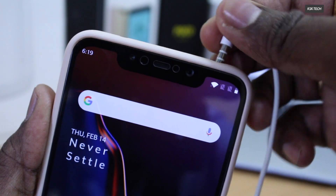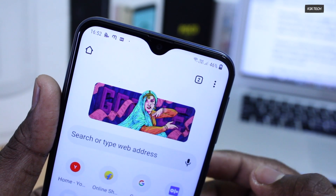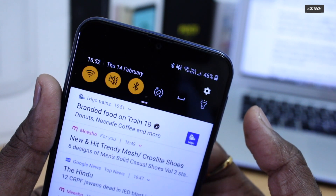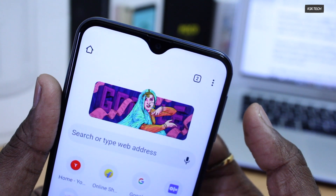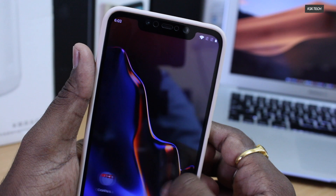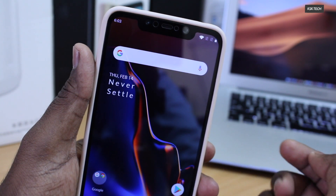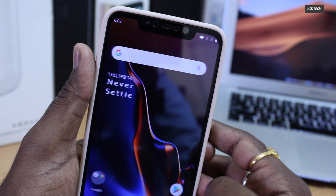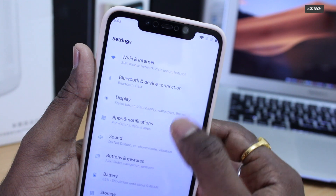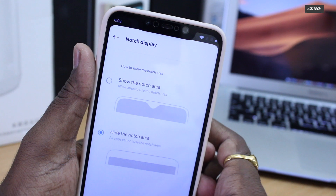Thanks to OEMs like OnePlus, Xiaomi, and Samsung, they figured out this issue and included a tiny notch on their current smartphones. With a tiny notch, it's easier for the user to see toggle icons or notification badges on the status bar. But what about people who completely hate the notch? Unlike Apple, Android manufacturers did an amazing job by including a Hide Notch option inside settings. For example, in OxygenOS, inside the display settings, you will see an option called Hide Notch. When you enable it, the OS hides the notch area — but it only works for applications, not the entire system UI.